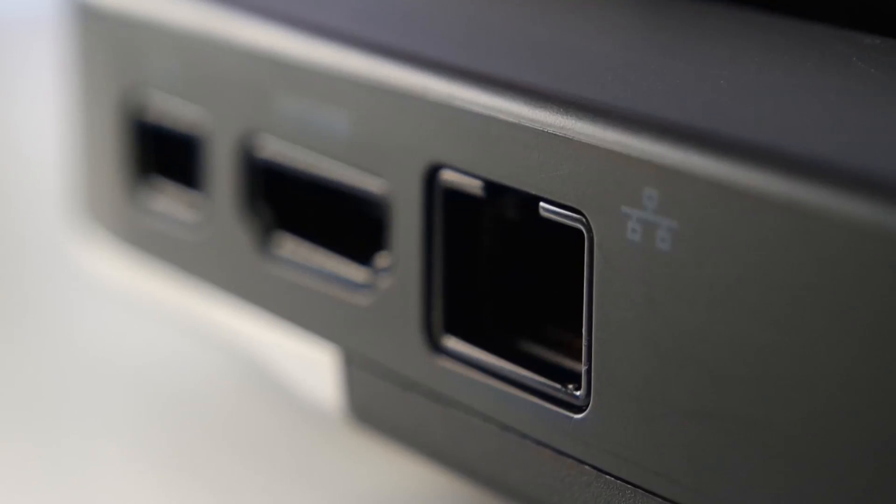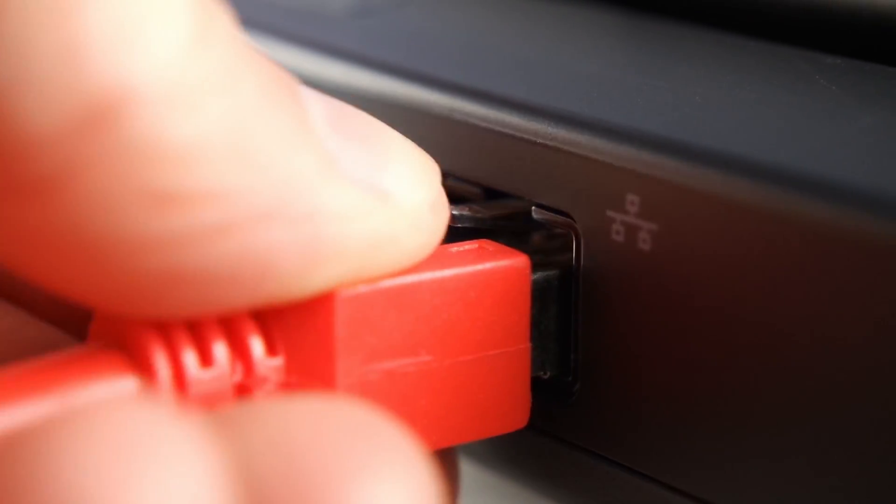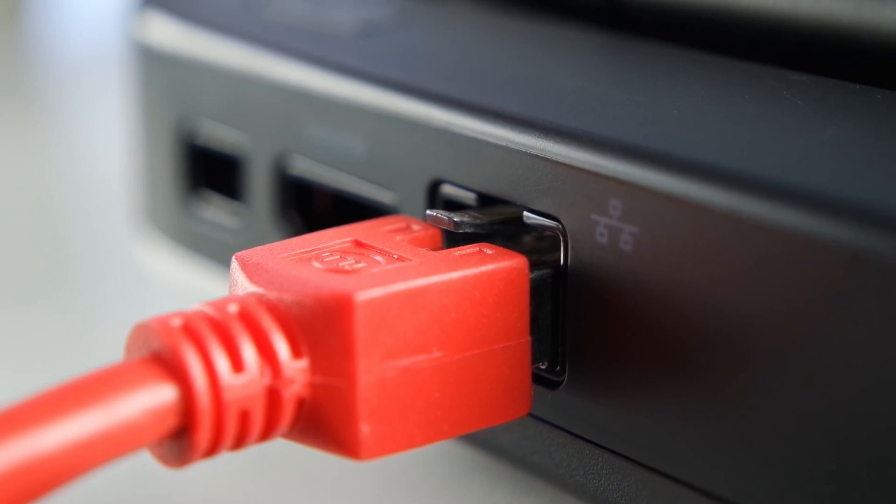Next, make sure your PC is connected to your router via ethernet. If your router is downstairs and your PC is upstairs with no way to connect the two, I was actually in that exact situation and found the perfect solution. You want to source a Wi-Fi extender — connect it to your network, plug it in near your PC, and then connect your PC to that extender via ethernet. That enables your PC to communicate with your headset in a much lower-lag situation.